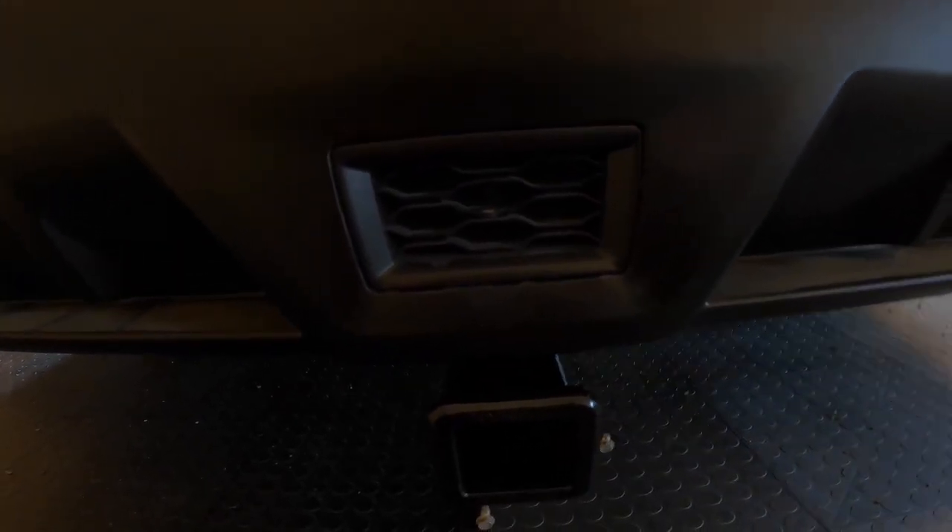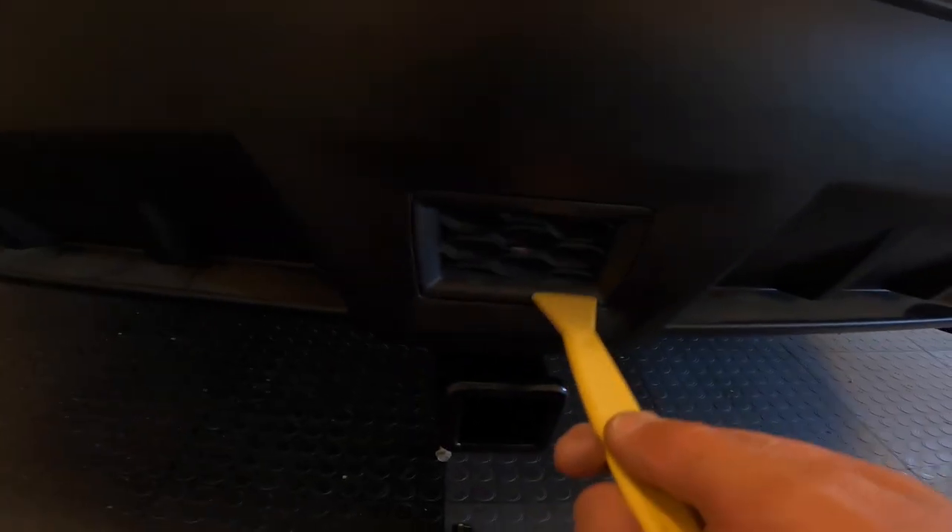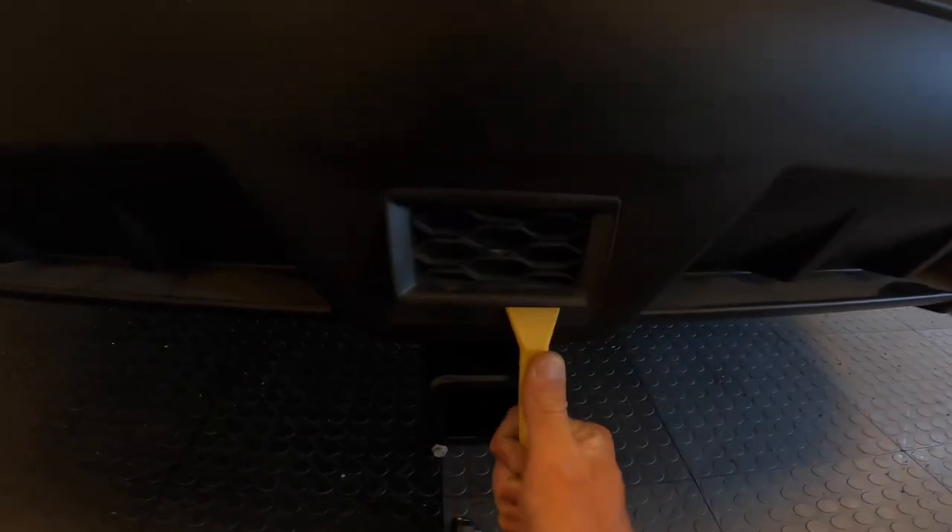I don't know how this is going to go. The right way is to take the bumper off but I don't feel like doing that. Basically, when you put this holder in with that setup on it, it goes in way easier with two hands. But because of this nut right there and that bolt, this doesn't go in all the way — it doesn't sit flush. So if you don't put this whole quick pulley thing on, it goes back in just fine, which is cool because maybe now I can run a third brake light. For now the hitch is on, that's all I really care about. Don't drill your thing — just leave it like this. Look how easy this is to get in and out — one-handed. You don't need that quick pulley thing. It'd be cool if it went all the way in, but without it mounting flush, I think that's a no-go.